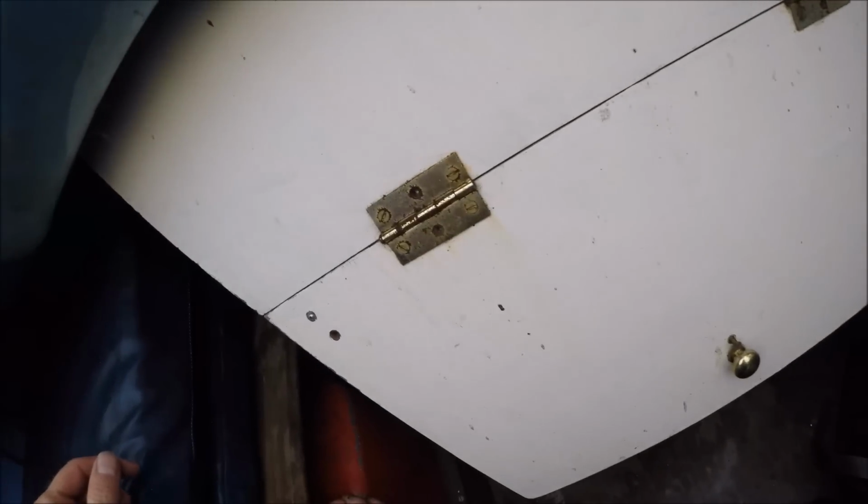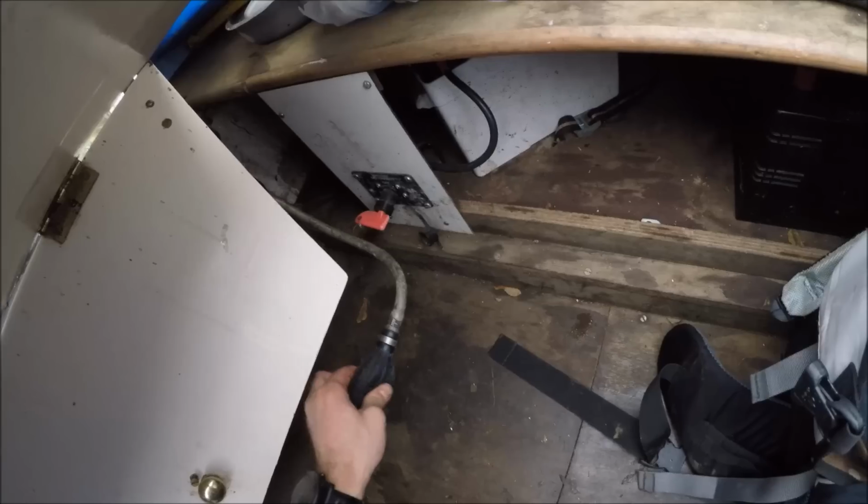So, yeah, and also if you're having trouble starting it, loosen this to let the pressure out. So after you check it up, do it back up again a bit, switch this on, pull down this to start the engine. Oh yeah, this is the fuel pump. So make sure that's fairly solid. Give it a few, don't do it too much, just wait till it's quite solid. And then also in the winter, you probably want to pull the choke out and push it in and out a few times, because when it's cold, this will help it start a lot easier. It should start first time when you do it this way.